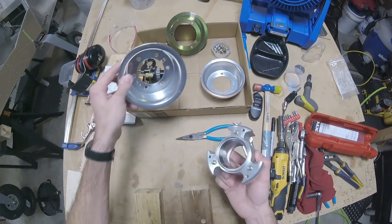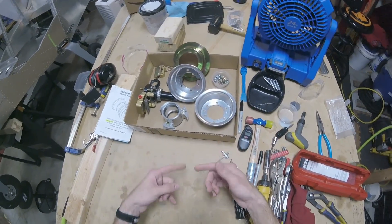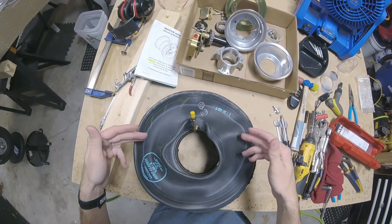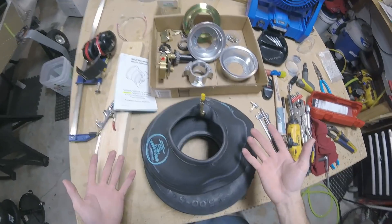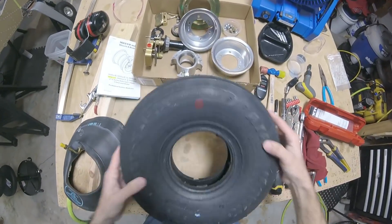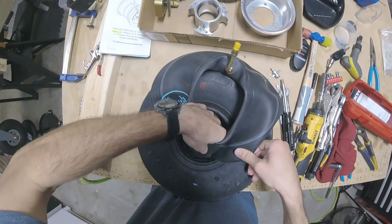I'm not sure if remarking matters a ton, but it's probably good practice. Now that the wheel assembly is apart we can get the tire and inner tube and start reassembling. We've got our inner tube and tire — we're going to put the inner tube into the tire. You can generally use baby powder to make it easier, but I don't have any right now. We want to find the red mark on the tire and line our valve stem up with it, so I'm just going to finagle this in here.